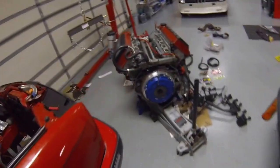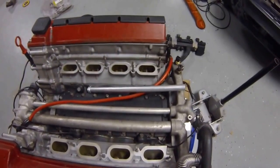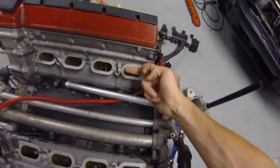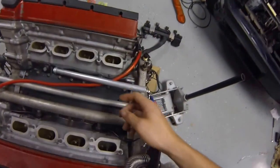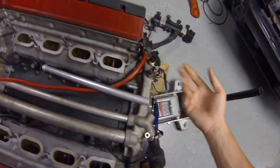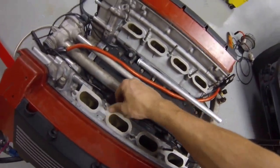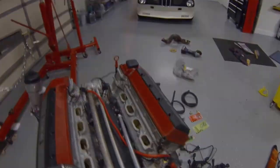So over here at the engine — after all that oil is in the intake manifold, this is what your intake ports look like. They're pretty stained with oil and everything's wet with oil. If I had let it go much longer, it would have just turned into black sludge and it would be very disgusting. So this is why I have the oil catch can, to prevent this.